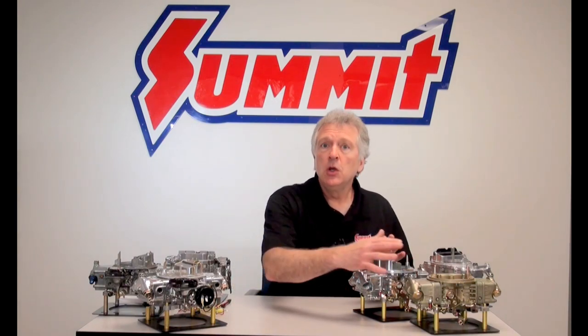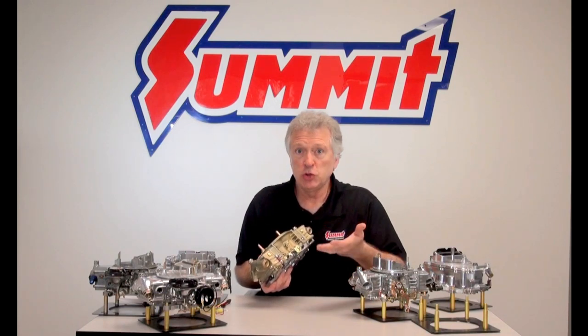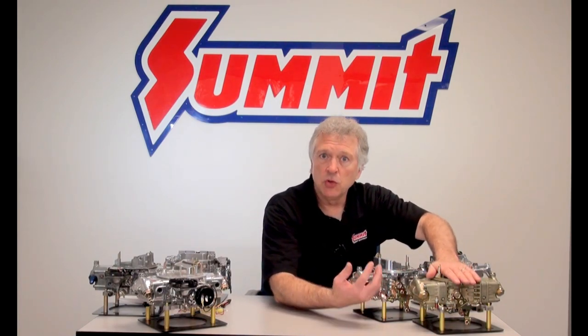Now we know why we need a choke circuit. How about the different types of chokes — or no chokes — on the performance line of Holley four barrels? Let's look at the easy one first. Here's a nice performance 4150 with no choke tower, no choke circuit, no choke. What this person is going to do on race day or in the garage tuning is just rely on a couple of squirts from the accelerator pump circuit to get that extra fuel in there. A trick I use is to take a shop rag, run it under water, wring out the excess water, and use it as my choke plate up top. It creates that choke flap and allows you to get that strong vacuum signal below because you're not open to atmospheric pressure. The extra fuel then comes off the accelerator pump circuit. That's a no-choke situation.